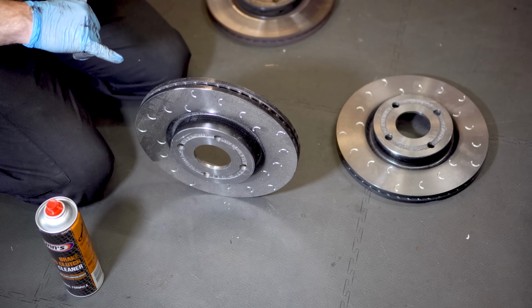It's always best to double check they are tight using a torque wrench. Apply more high temperature grease to the back of the pad that has no clip attached, and also cover the lugs that enter the caliper. This pad can now be balanced against the disc with the grease facing outwards.